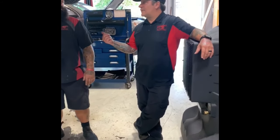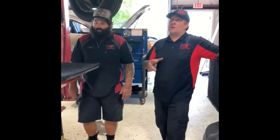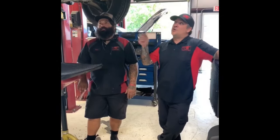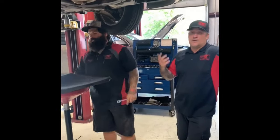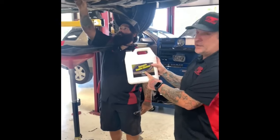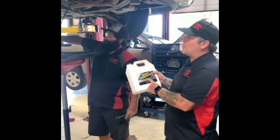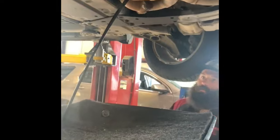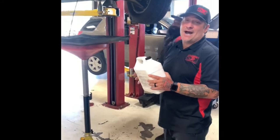We're back — Oz is going to go ahead and drain the old cleaner. I want to correct myself earlier in the video: I said the new engine was $700 — I meant to say $7,000, so a new engine would be about $7,000 in replacement. Oz is going to drain this out — this is the actual cleaner that we just ran through the engine for 40 minutes at 3,000 RPM, so it's going to be a little bit warm. It looks very dirty — you can see the dirt from the motor.